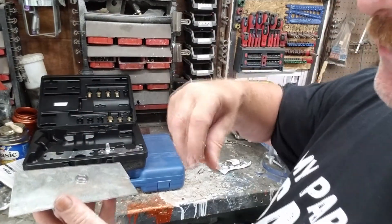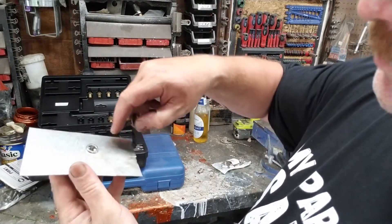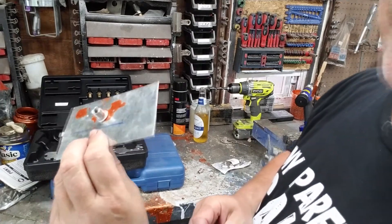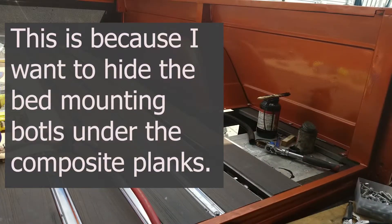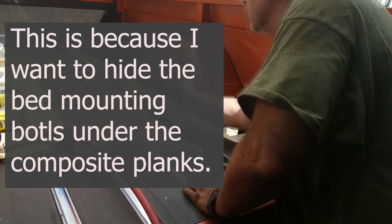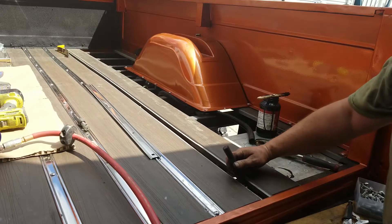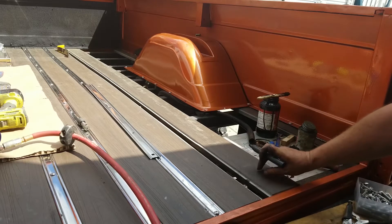Since I've undercoated everything and coated every piece of steel with 415 and then polyester-primed it, once I drill the hole I'll spread a little undercoat in there, then stick the fitting in to keep any moisture out — maybe roofing tar or something thick. Because I put the bolts underneath to hold the bed to the frame, that's going to cause it to ride up, so I'm going to mark right on the side where the bolts are and mill across the bottom to make a little relief there.